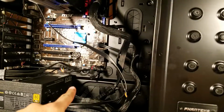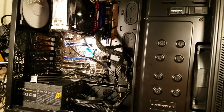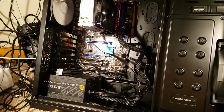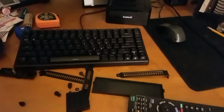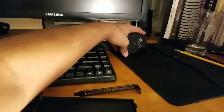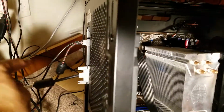will spin up. I do have a speaker plugged in down here, so we should have heard a system beep when everything booted. Did not hear that. The screen is still black. And we'll just give it another minute and make sure nothing else happens. But it'll just sit here like this. It won't keep tripping the power supply like it had been before, but it won't actually boot or do anything, and the keyboard and mouse do not work at all. Normally you would see an LED showing that the mouse is plugged in and on, but nothing. And the display, mouse and keyboard are plugged in.